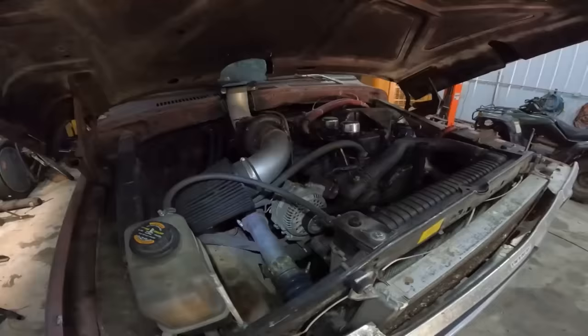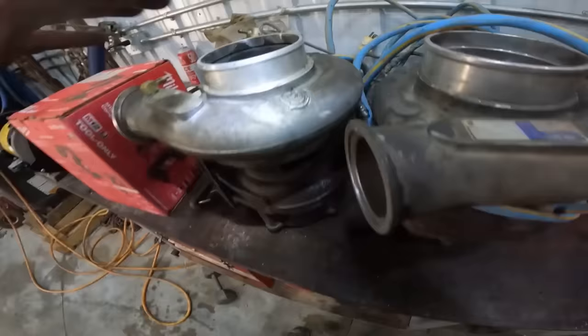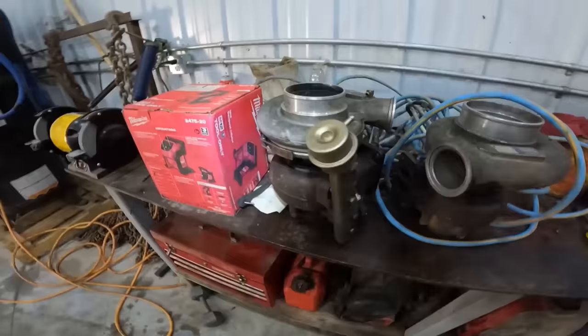What did not work great on this engine was the medley of turbos it went through. So this turbo here with the allegedly welded wastegate, I mean, I wasn't even giving her that hard. This one blew on the way out of town. So we were on the outskirts of Grand Prairie, and this turbo wasn't making any boost. All it was making was a bunch of weird noises. So that was turbo number one, about 4 or 5 miles into the trip.